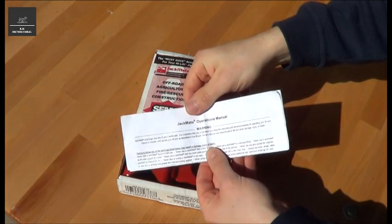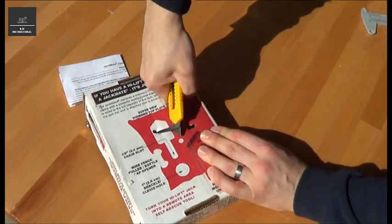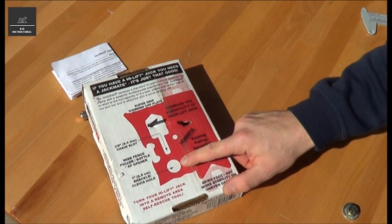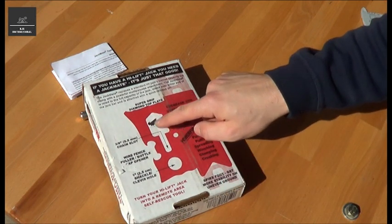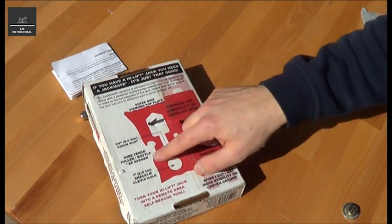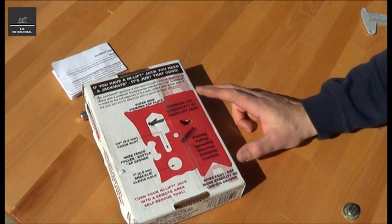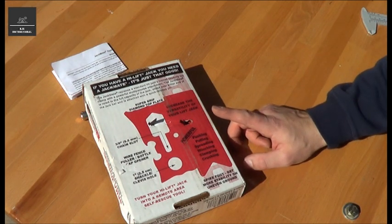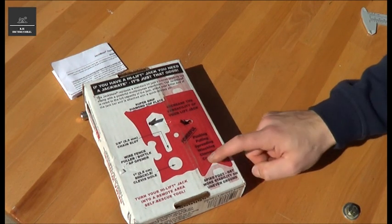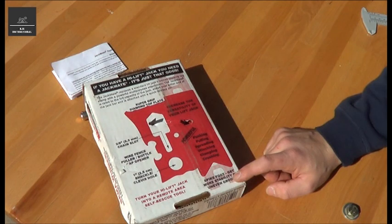It comes with some instructions, an operation manual, and as the packaging suggests, it's got a 1" or 25mm hole, a chain slot, a chain locking mechanism, a super grip diamond top plate, and a Y puller / bottle opener. And the beauty is you can use this to replace the top clamp of your high lift. You can use it for pushing, pulling, spreading, winching. Winching will come in really handy, clamping and also crushing, and it's also got this spike on the channel section which goes over the high lift jack for a better foot grip if you need.